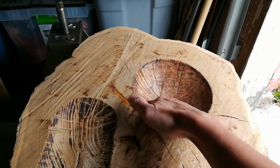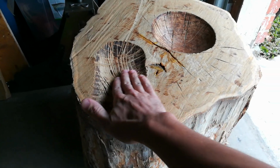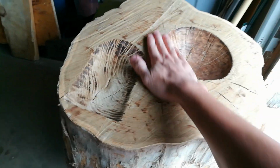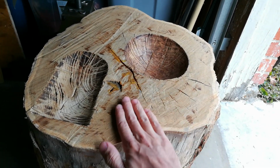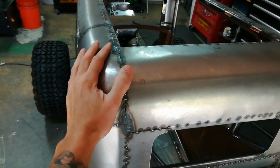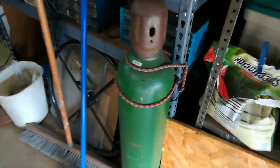This bowl was cut with a circular saw, and I added this one, a shallower one, just so I could get a little bit wider difference in profiles, and then two flat spots here. And basically you hammer in here, which creates tucks in the sheet metal, and then you have to hammer them back flat here, which shrinks them so that you get shapes like this. And they were all hand planished to get all the roughness out. For that, I basically used gas cylinder caps and the appropriate hammer.